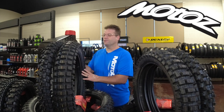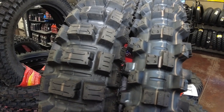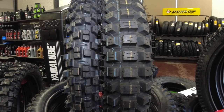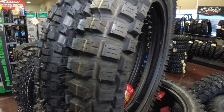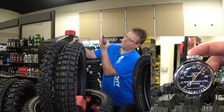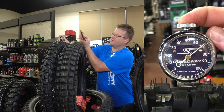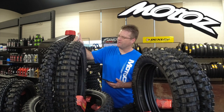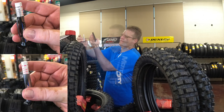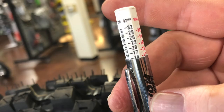That's absolutely huge. It's got rim protection on here as well. When it comes to the actual tread compound and construction, the first thing you'll notice is the concave mark in between each of these tread blocks — that allows the carcass to actually bend down, flex, and lock into place, giving you extreme traction on the trail. Let's grab a quick durometer reading: we're looking at right at 65 on the rear tire. For the front tire, it's a little bit harder, right at 70. Looking at tread depths on the rear tire, we're looking at 20/32nds, or right about 16 millimeters. On the front tire, we have 12 millimeters and about 14/32nds.